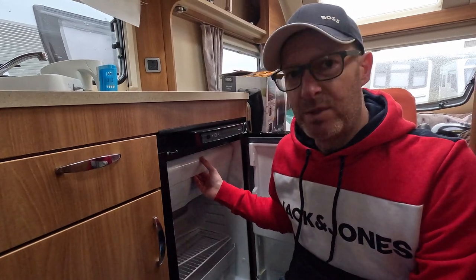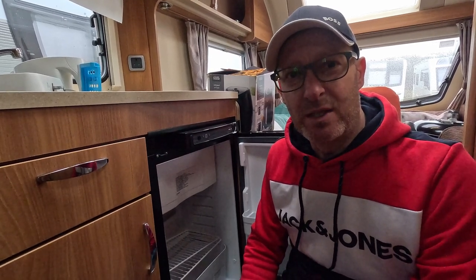Just a slight gap open there - it will stop you having to come back in the new year and finding you've got multiple mould patches in your fridge, something that you could easily avoid. Something else you can do is come into the caravan and have a look around. If you've got any signs of damp you'll be able to spot it - it will darken the actual colour of the walls. You can feel in some of the corners where there might be more chance of build-up, and think about where the roof is constructed and where the actual runs of the caravan join at the front, back, and down the sides.